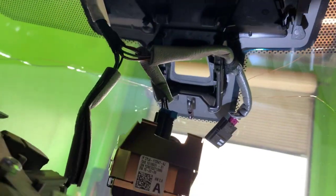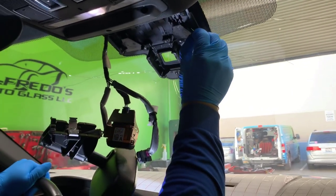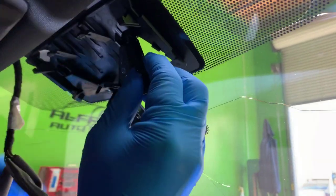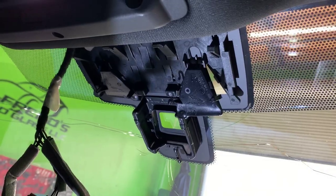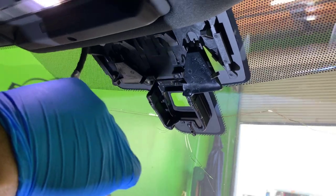I'm going to push from the back to give me some space to insert my tack puller and separate it. Sometimes you're going to have to transfer them to the new glass, so I'm just squeezing here. You do not want to break it because they are going to have to be transferred to the next windshield. This is the right and the left — we'll just leave this here for now.